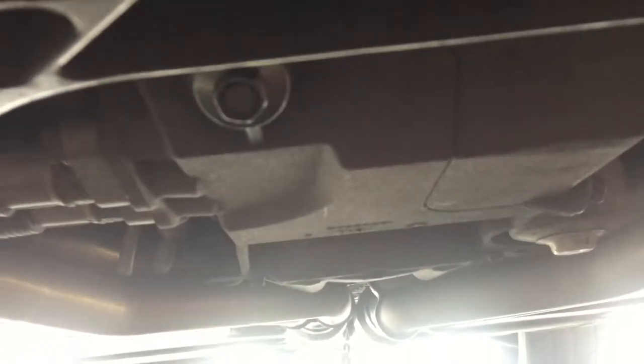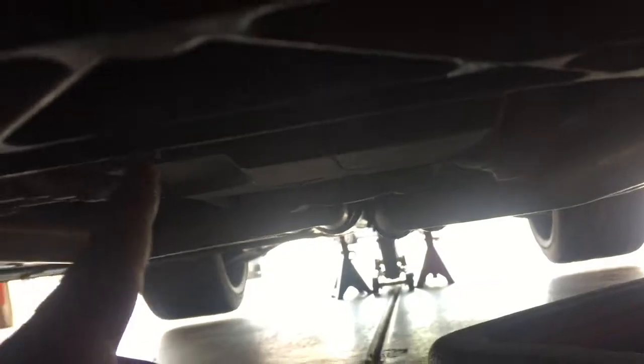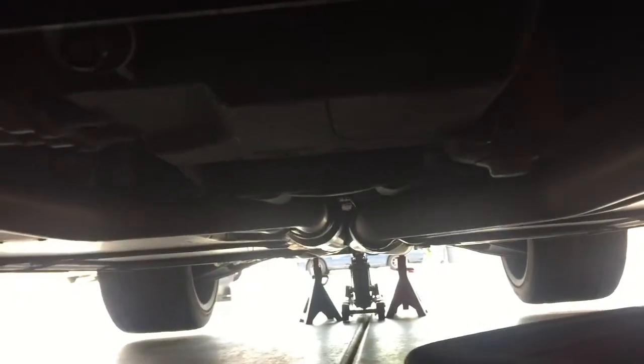So the first one is right up front on the oil pan facing forward. The second one is off to the side here. You do have to undo both so you get all the oil out of there, and the oil filter is of course right there. So again, if you're coming in underneath the car from the front, you'll have one on your left and one on your right. So let's get these off.